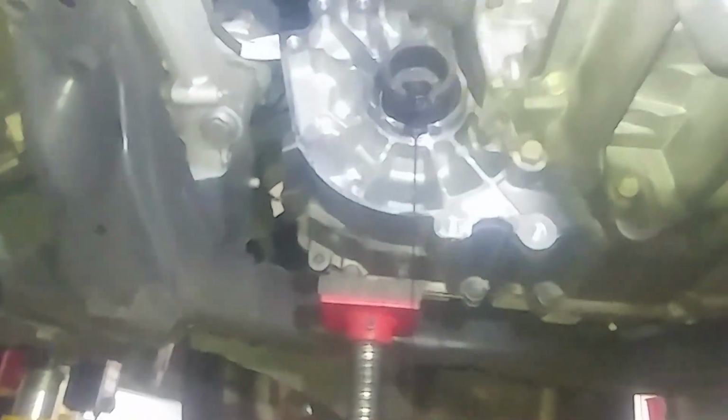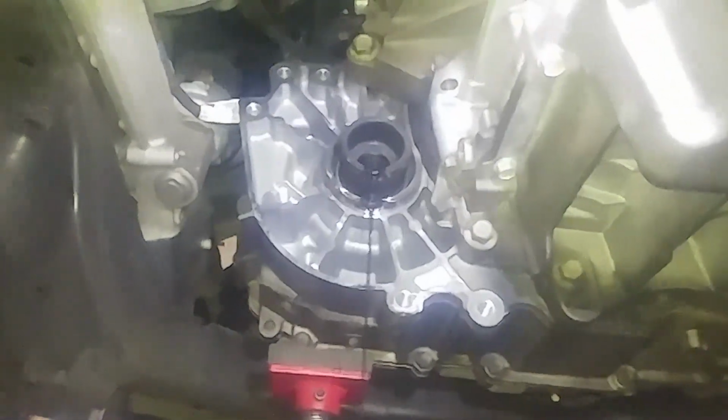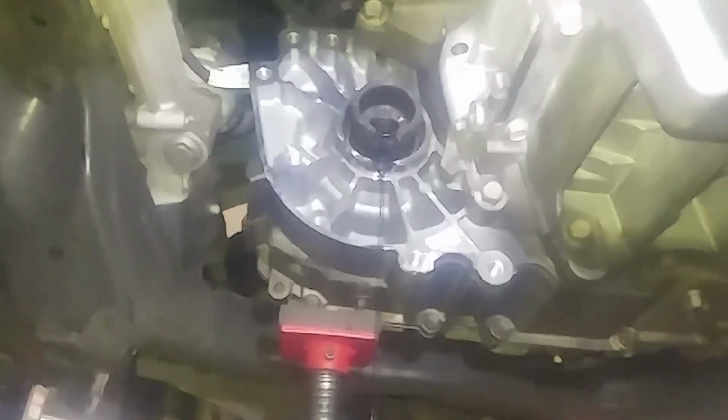Out of the way, and it is a little bit loose because I did loosen those two bolts there, so those two bolts will be it, and we can slide this out, I believe, and down. Finally. They were two 18 millimeter bolts. Already did loosen them, as I mentioned. Not sure how much fluid will come out. We did drain it, but we'll see. And we got fluid coming out. Probably some delicious transmission fluid, but there we go. It is out.